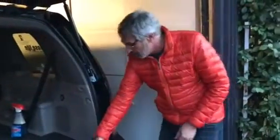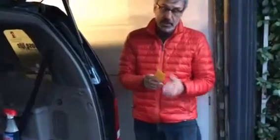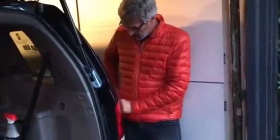To remove the taillight assembly I'm going to use this plastic tool so I don't scratch the paint. I'm going to insert it over here on this side where there is a slight wedge between the car and the taillight assembly, and I'm just going to pop it out.